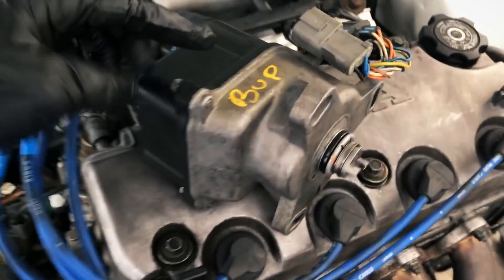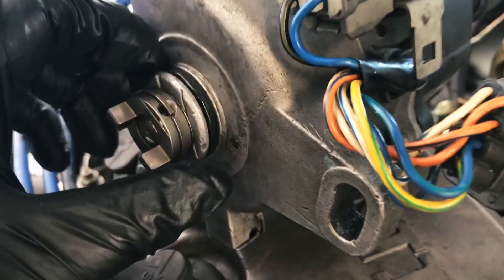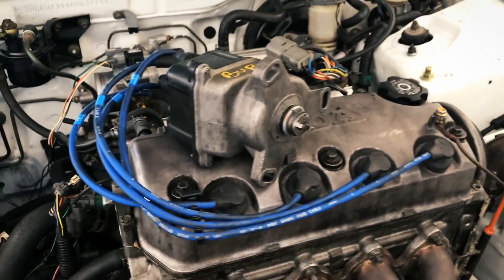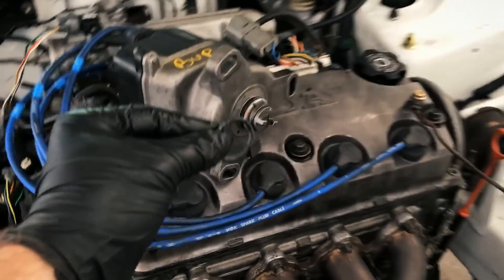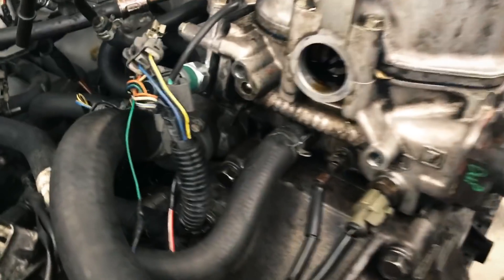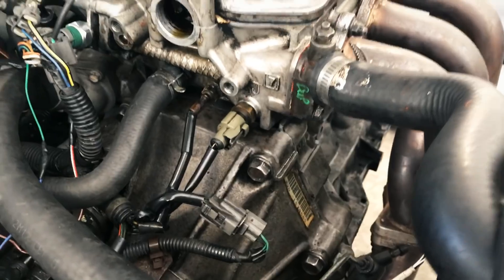Super easy — just these three 12-millimeters. This one I actually got out of the junkyard, that's why you see the BUP on it — they label it so you can't just return it and get money back. Here's the old O-ring. It doesn't look terrible, but it's probably been on there for a while since it came out of the junkyard and I did not replace it before. I just wanted to get this thing running, so I'm replacing it with the new one from Honda. Simple matter of popping that old one off, lubing this one up, and putting it back on.